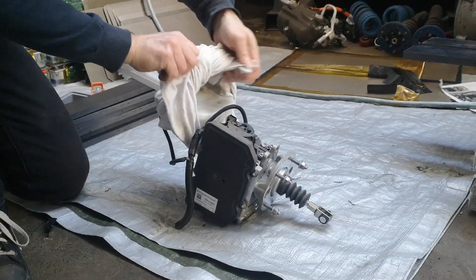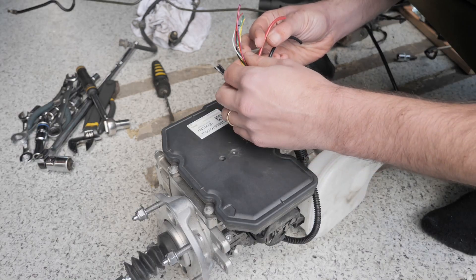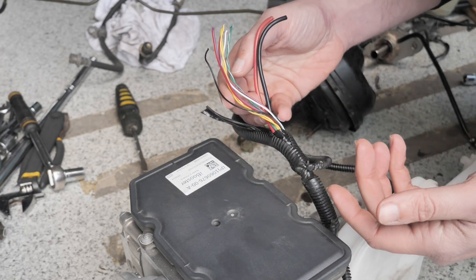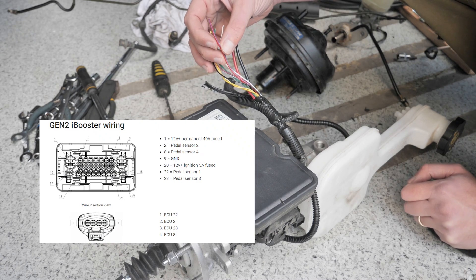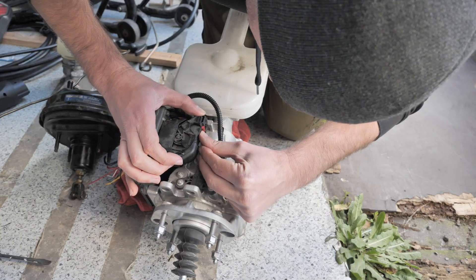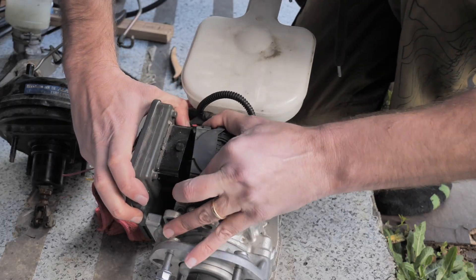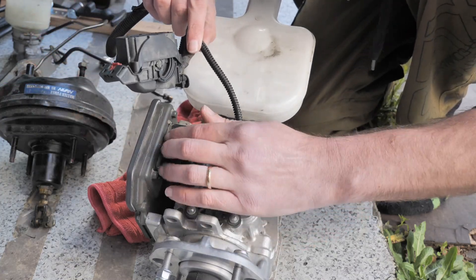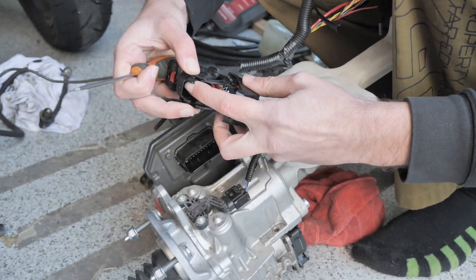There won't be any surprises when I have double the power. It turned out somebody about 20 minutes from me had an iBooster for sale. So I gave them a bunch of money and I figured out how to wire it up to see if it works. So two big wires — I'm assuming these are the positive and negative to the battery. But then these other wires, it seems like every iBooster has different colors for some reason. But I found the pinout schematic online, and they tell you exactly which one to wire up to the key. It's number 20. If I power my brakes with a Tesla brake booster, does that mean my car is Tesla powered? I always see that title in conversion videos, but they're usually just using Tesla batteries, so I guess technically it's Tesla powered, but not really.